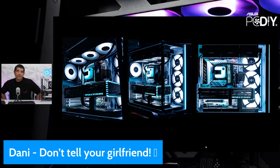And normally, I recommend to most people, 13th gen is very strong. You can usually run generally 7000 MT/s with pretty high consistency. There will be some CPUs that have a little bit more variability in terms of their memory controller that you won't maybe be able to. And on Z790, you can generally see pretty good success starting to get 7200, 7400, maybe even 7600. But definitely you start to see more margin. And one of the big benefits of a 2-DIMM board versus a 4-DIMM board is going to be that increased stability for even higher clock speeds.